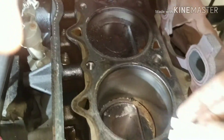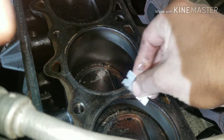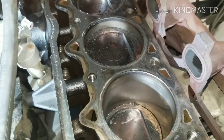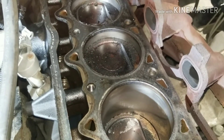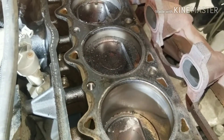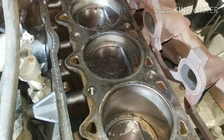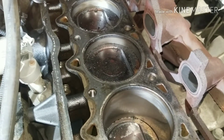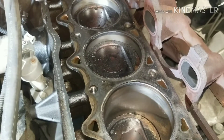I'll go over it with some Scotch-Brite and start buffing on it. You want to get it pretty shiny because you don't want anything sticking up. Once you feel like you've gotten it, go ahead and take some Carb Spray and spray it. You can see if there's any gasket material left — it'll come up and look black because the gasket material is getting wet. That's one of the tricks I've learned.